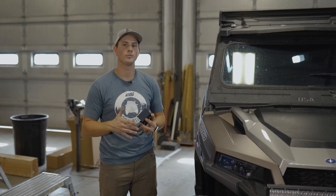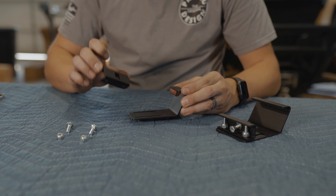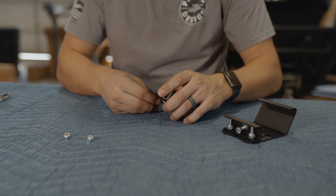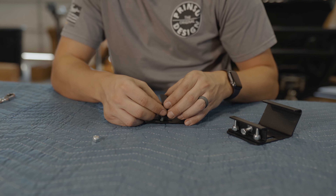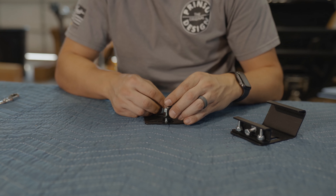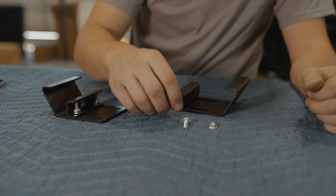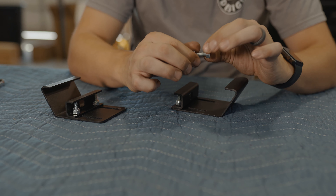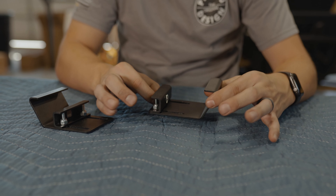Now that we have the front of the rack loosely installed, we're ready to move on to the back and assemble the mounting brackets. Grab the two brackets and place them together. Grab a carriage bolt and put it through the bottom on both slots. Then grab the nylon locking nuts and thread those on — don't tighten them too much because we're going to adjust these once they're on the UTV. The last step is to grab this small bolt and flange nut, thread them backward just a little bit, and feed them through the rectangle until the flanges catch.